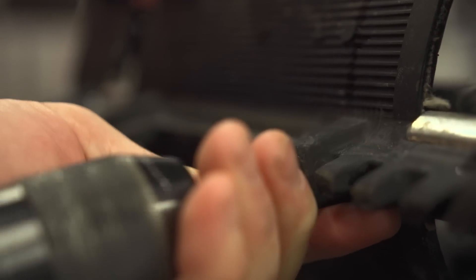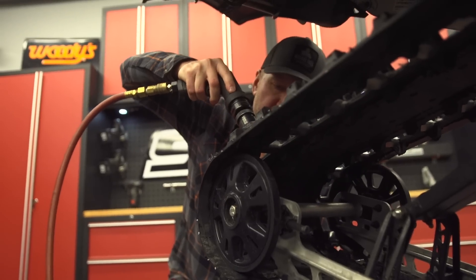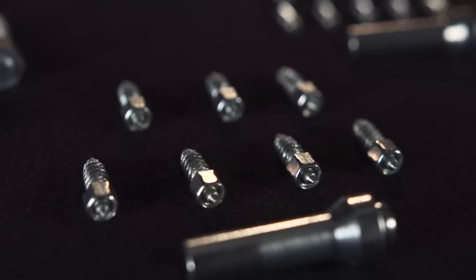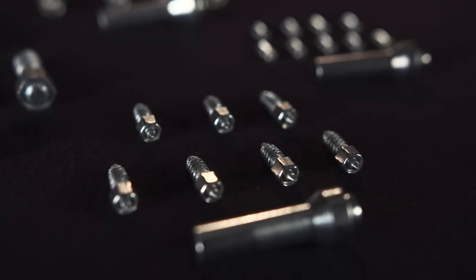When used in harmony with the twist screw install tool, the process is pretty much what you'd expect — you're drilling screws into a rubber track. It's not hard, time consuming, or technical. The insert and removal tool grips the stud with authority and also doesn't harm the carbide tip, which on the 32 millimeter Tack screw is the most pronounced of the twist screws, giving your sled that added bit of traction for both acceleration and stopping control.